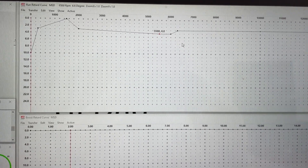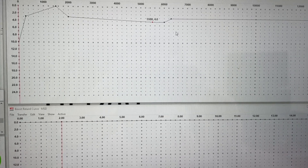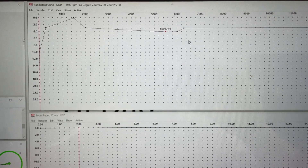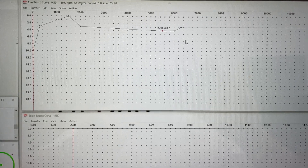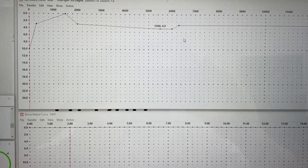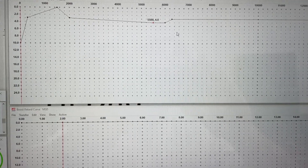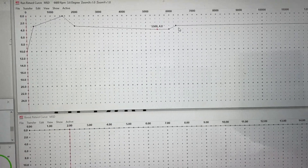And where did I learn that? Engine Masters. I'm not trying to be arrogant about it, but when I went to Engine Masters I just listened to everybody. I overheard Judson Massingill and someone else mention that dropping timing at peak torque actually brought the numbers up — maybe two, three, four foot-pounds of torque. It's not a lot, but it's something. So I started doing it from that point on.